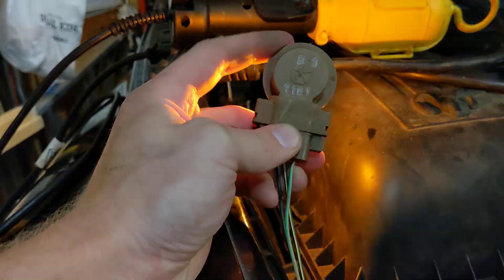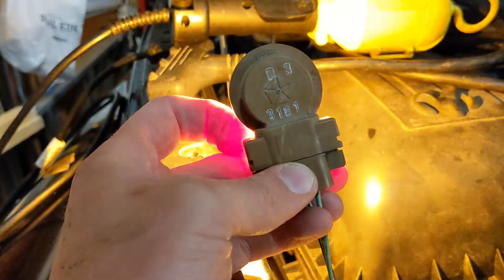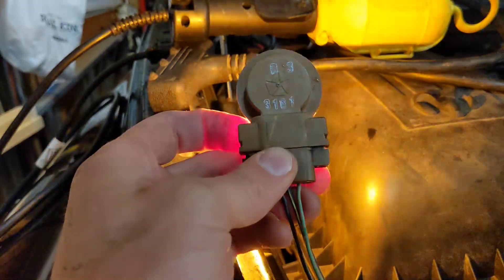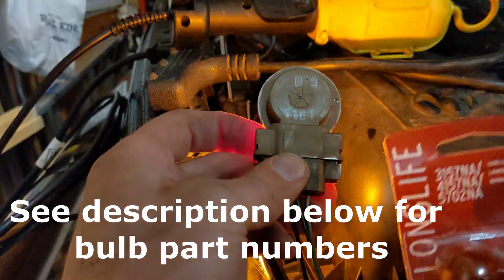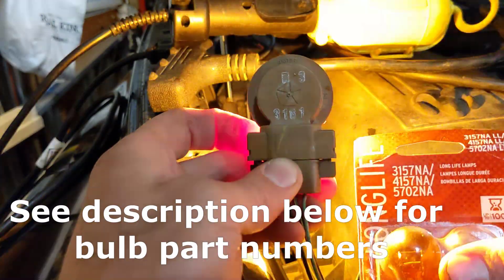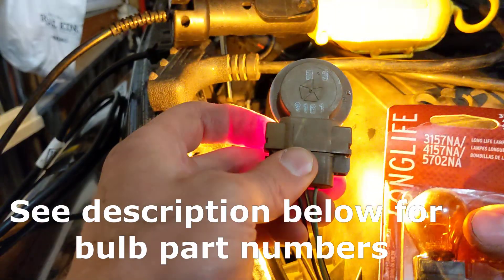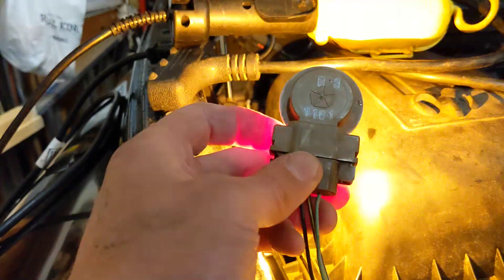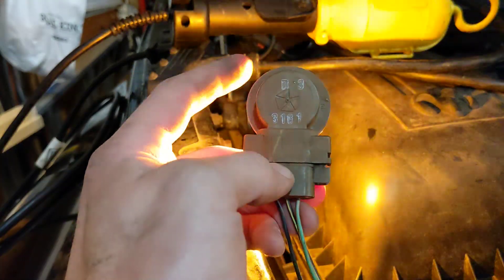It's a weird problem. It might be driving you crazy if you got to the point you were searching for a video on YouTube on how to fix it. Hopefully that fixes it up for you. The lamp that goes in here, if you're looking for that, is a 3157A or NA. I'm using an NA that came out of there — that worked fine. The 3157A is what came in the TYC unit, and apparently that works just fine as well with the correct base. I'll drop a link below to Amazon where you can pick them up if you need one. Hopefully this was helpful to you, and if it did help you out, I definitely appreciate you giving the video a thumbs up.